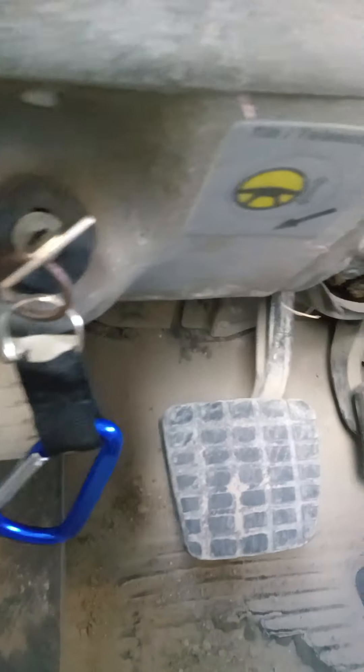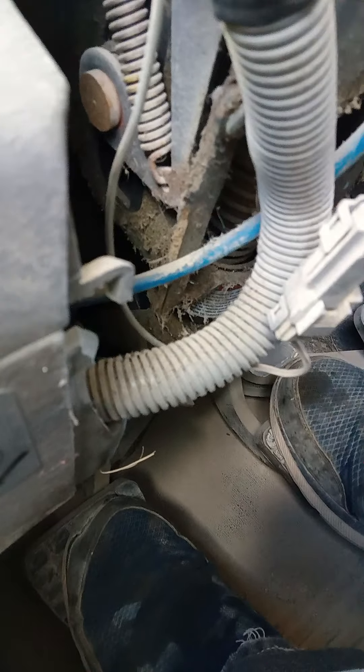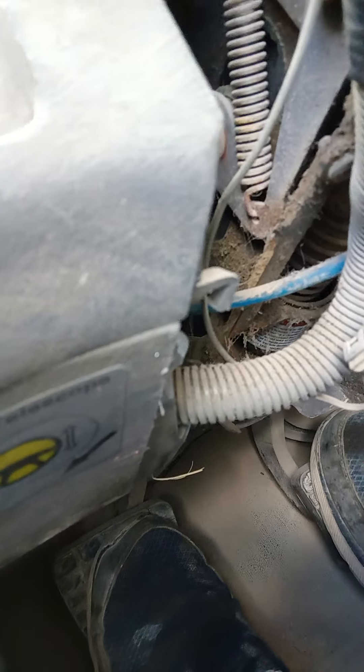Now, if I go to stop, I'm going to push the clutch to the floor and ease the brake to stop — that way I stop smooth. That's the demonstration of this class: how to stop the truck and get the truck rolling so you're not shaking and jumping. This is an Eaton transmission. That way you're not popping the clutch, shaking, all that good stuff.